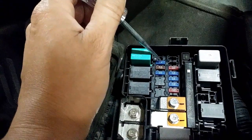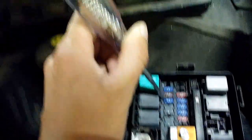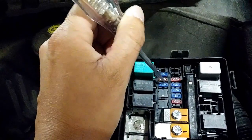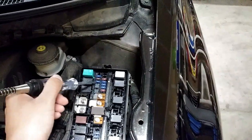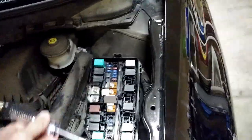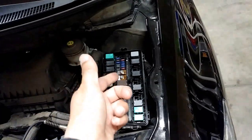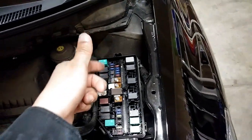These two 15A fuses here — I'm touching them and the light doesn't come on. These two fuses are for the headlight. I'm touching those headlight fuses and the light isn't coming on, but it doesn't mean the fuse is bad. For some fuses, you've got to turn on whatever the fuse is used for — you've got to turn it on to get electric current, to get power running through the fuse.